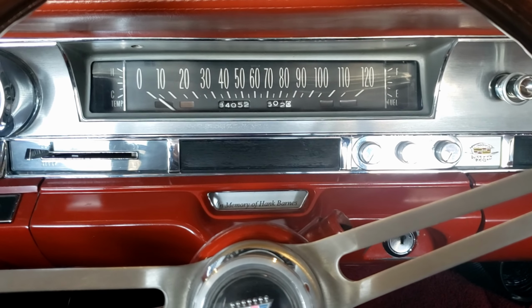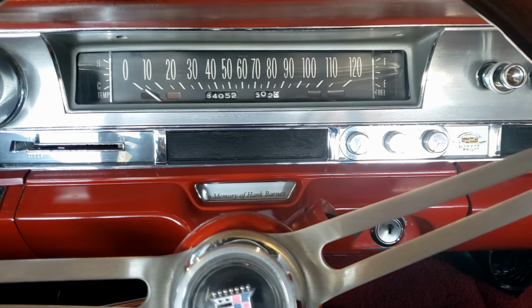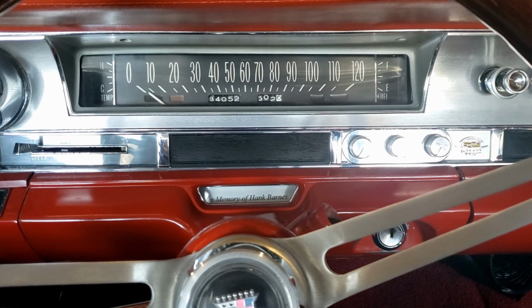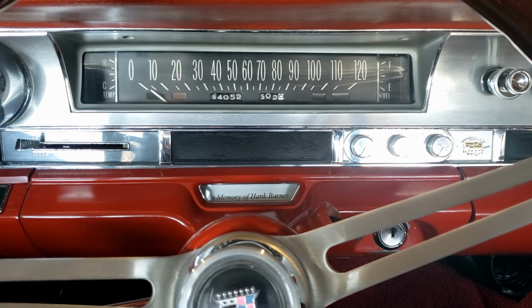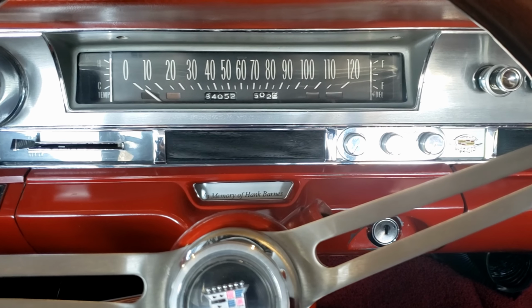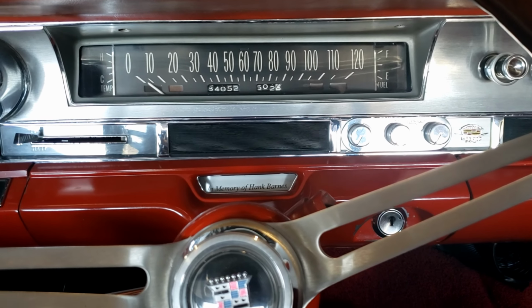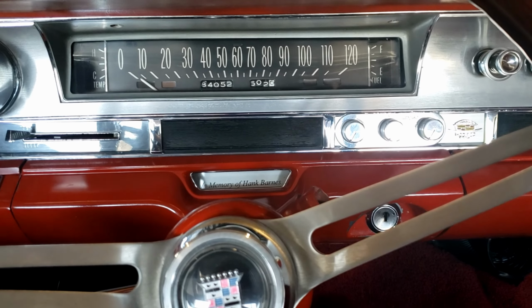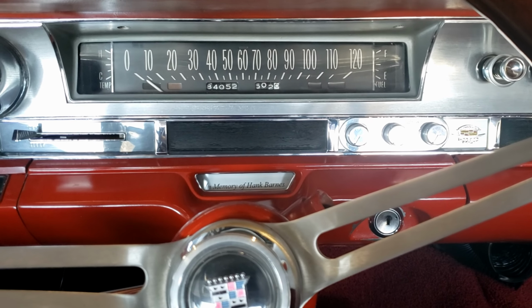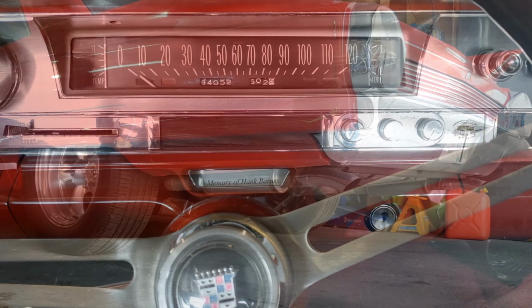And that's still settings I'm messing with in the fuel injection, but it breathes a lot, and it's funny, it really wants a lot of fuel at certain parts of the lower RPM range, and others it doesn't. And it doesn't really run good till it gets over 2,000 RPM. So that's kind of the nature of the cam. So let's just get on with it. And I'll stop this, reset the camera, and we'll try again.